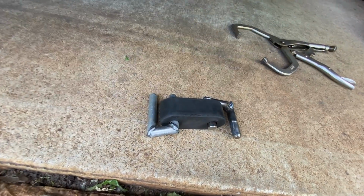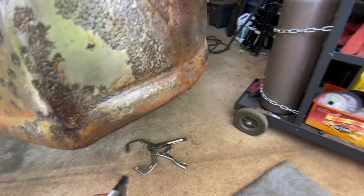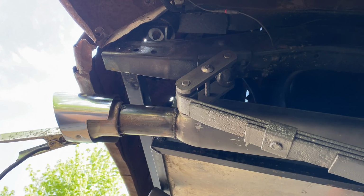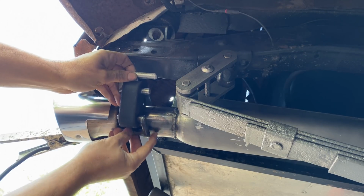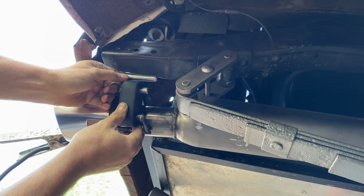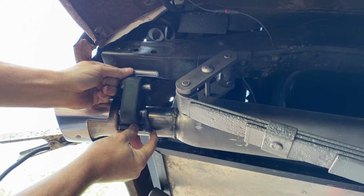My hanger bar support things ready, and I know you're supposed to put these on the opposite way around to stop them slipping off. So this is going to get welded on to, this is hard to do with one hand. Tell you what, I'll put you down and you can just watch. As I was saying, this section will be, let's see, which way around do we want to go? Probably that way. That'll get welded onto the underside of the silencer extension, and then I need it kind of tight, so I will weld it about there, and then that'll allow a little stretch in the donut. I'll just tack it on for now, make sure it's in the right place, and then fully weld it.